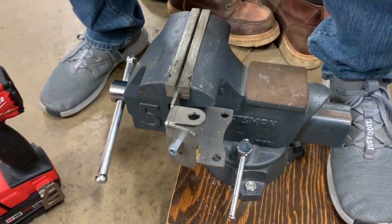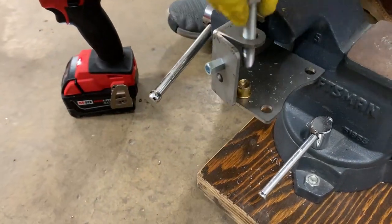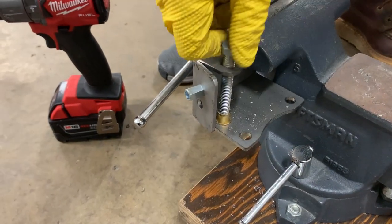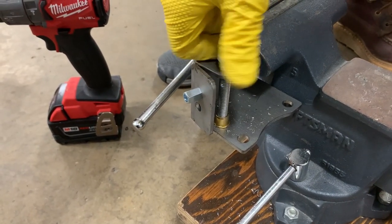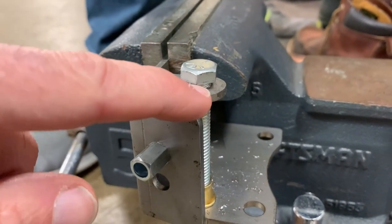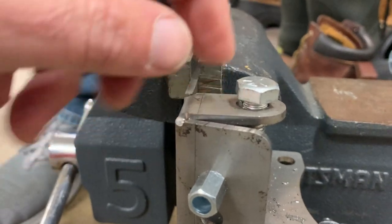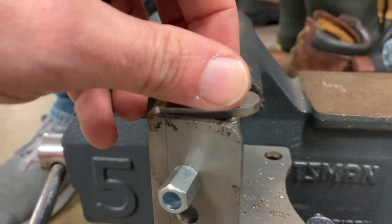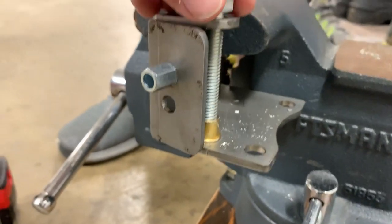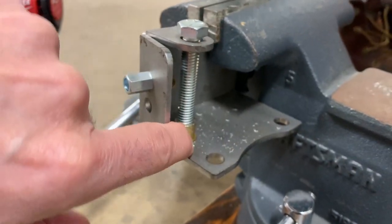All right, so now we're gonna grab the bolt while it's still clamped in there and see if the bolt will screw into it now. Is it going in? Yeah. So if you look here, folks, you can definitely see that the bolt is off center of this hole. Drilling it out a little bit definitely made it better for this to go into the riv nut. It's a good thing Andrew found that, so we did not cross thread our riv nut.